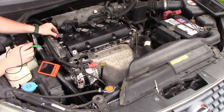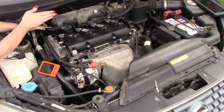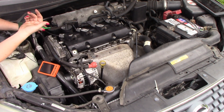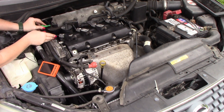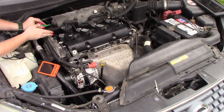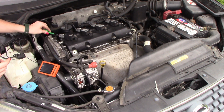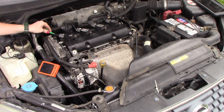I'm going to reconnect this and back-probe it. The last wire would be the control wire because it comes from the PCM — it's going to tell the coil when to fire. It's a different color from the rest. We have red and black which are constants: red is power across the board, middle is ground across the board, because the transistors need power and ground. And then the computer will be the one telling it to go ahead and fire. I'm just going to make sure we have that signal.